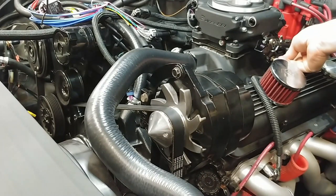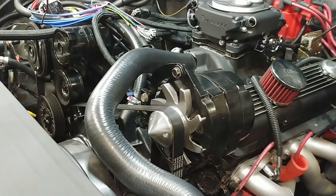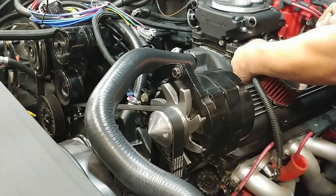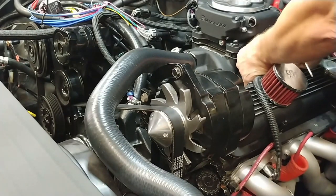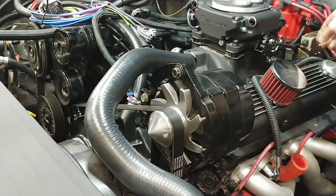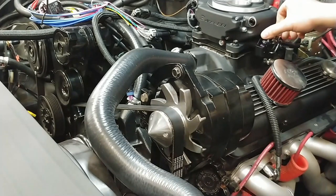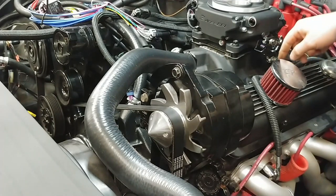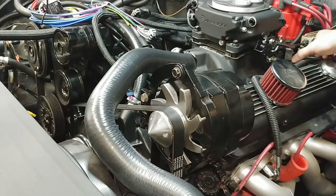And then this guy is next. I'm going to try to ballpark that one. And there's a detent right here you can push in and actually pull it out. Clips on like that. So supposedly when you're at wide open throttle, you can see how that spring collapses. And that's supposed to give enough tension on that to where the pressures in the transmission itself are within spec. So that's kind of a ballpark.